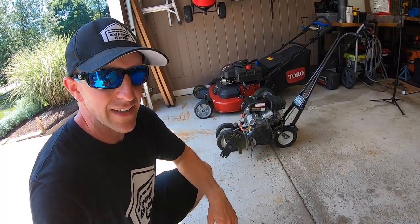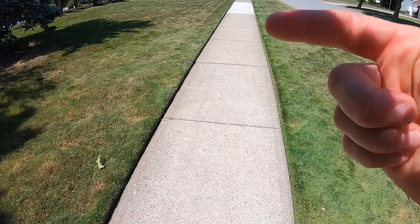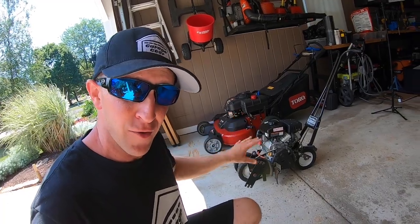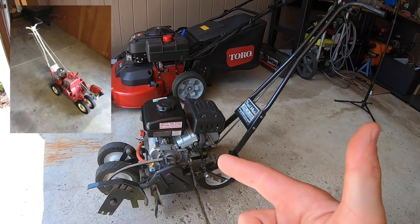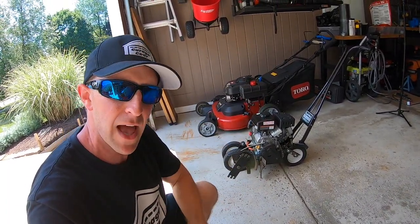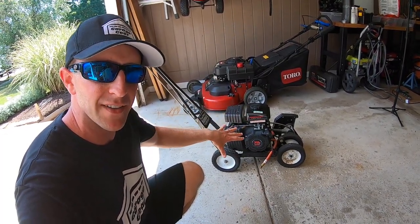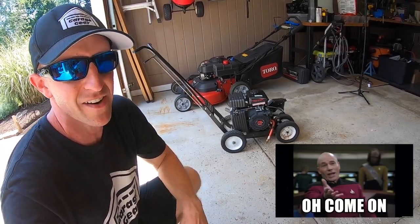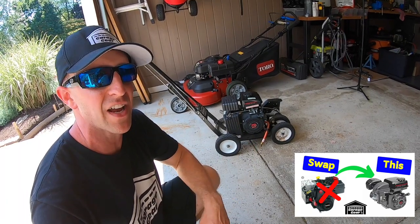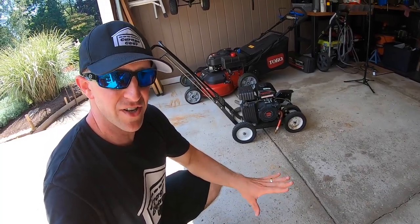This edger comes with a story. When my wife and I first moved in here, I decided I was going to use one of those wooden stick edgers to get this whole sidewalk done. What the hell was I thinking? I did about three concrete blocks before the neighbor came out and said he had something in his shed for me. He pulled out this old commercial-grade Trailmate edger and said I could have it for free. Thanks, awesome neighbor — his name was Phil. The frame was originally orange and in good working order, but the engine had more than $100 worth of problems. So I ripped the engine off, spray painted the whole frame black, then went to Harbor Freight with one of the only 20% off coupons valid on a Predator engine and got it for $80. The engine fit perfectly on the old frame — easiest engine swap ever. I even added an oil drain hose to make oil changes easier. Anyone who says Predator engines aren't worth it, I beg to differ.